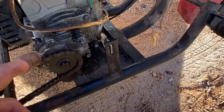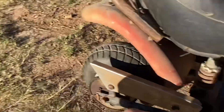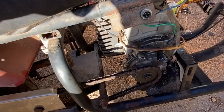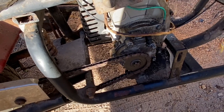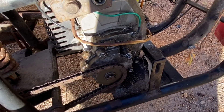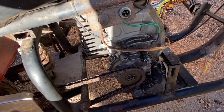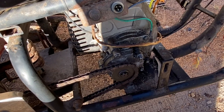So I think that's what's the problem. It did actually drive on its own down the hill, but it would not climb back up the hill - just revving and revving and it wasn't doing anything. So I think the centrifugal clutch in there has something wrong with it, or it's really worn down and needs to be replaced. I'm guessing it's really worn down as everything on this bike is a little bit worn. Anyway, that'll be a topic for another video - we'll replace that. Thanks for watching and I'll see you in the next one.